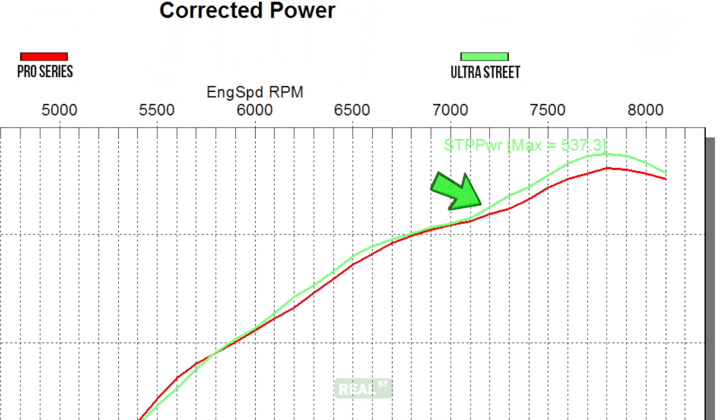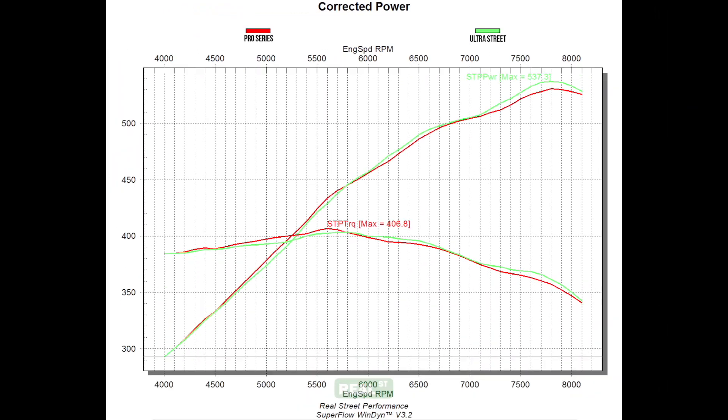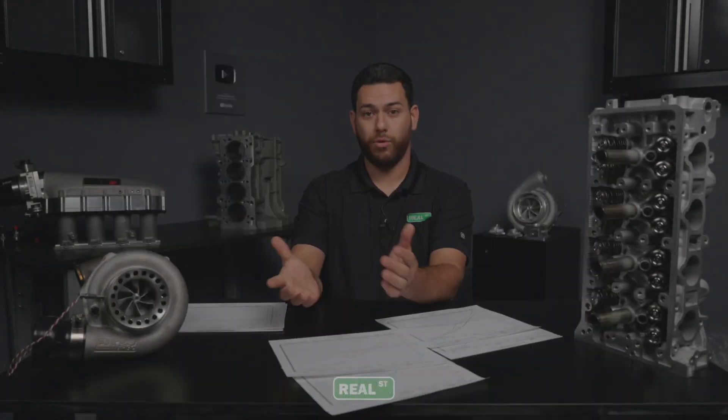We'll see an increase in the higher RPM with the horsepower itself, and that may be desirable in a drag race environment where you'll be specifically in a higher RPM for more of your run. Now that we have those two runs in the books, let's go back to the engine dyno and see what happened with the 90mm throttle body on the Skunk 2 Ultra Race manifold, the largest of the three used today.